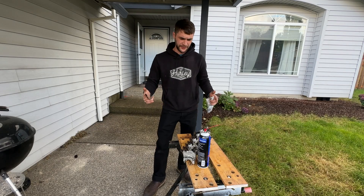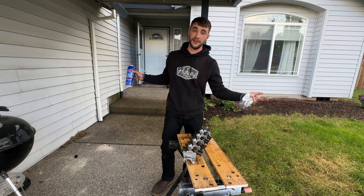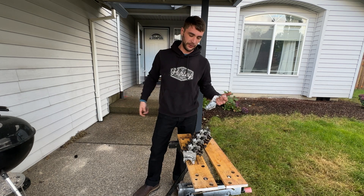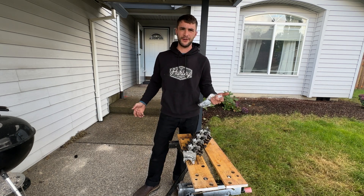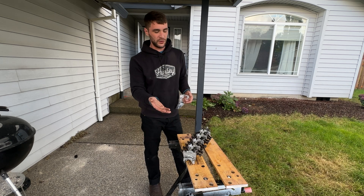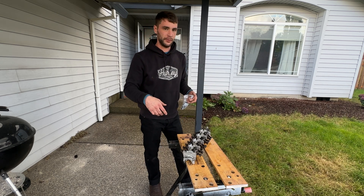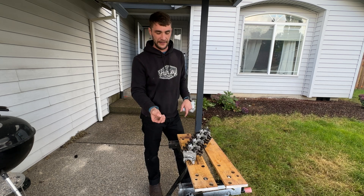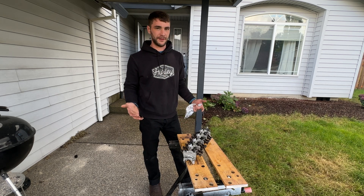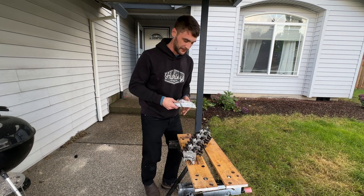All right, let me show you the next steps. Now here's the deal — there are a couple different ways this can be done. Of course, you can use a helicoil, and most auto parts stores carry them. The one thing I don't like about helicoils is you already have to drill and tap the hole, and almost every time I've used one, when you go to unscrew the bolt you take the helicoil out with it. They're just a huge pain to use, plus they're not a very strong fix and they don't last as long. So helicoil is not my best friend.